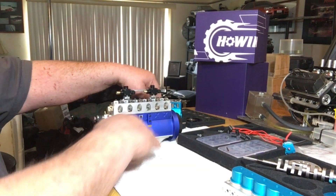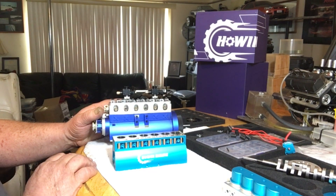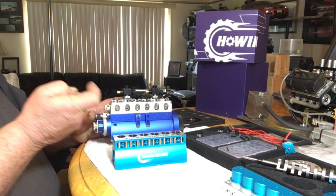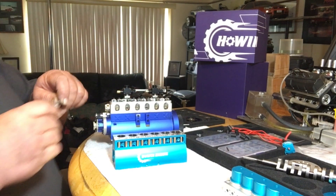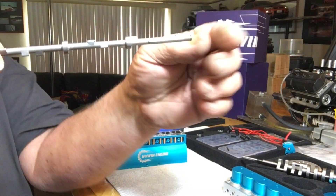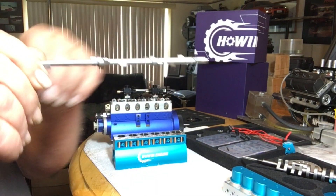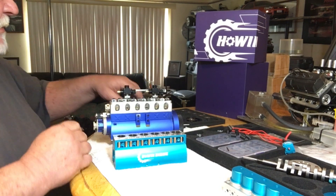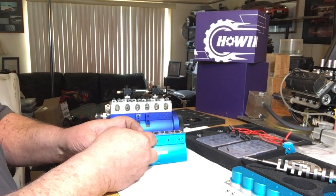As we go down, you're going to see there's no side cover on the prototype — it has two square blocks that screw in here with hooks. Because the camshaft did not have a bearing, this production camshaft has a journal that sets inside the block tightly and turns to keep it from flexing up and down and bending in the middle from stress. The side cover on the production engine actually bolts on to the side, just like a real engine — you can take it off.